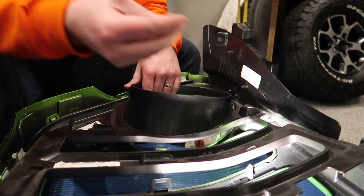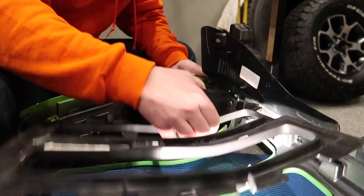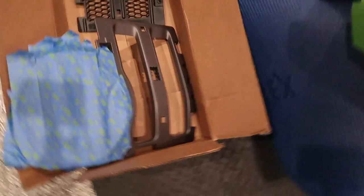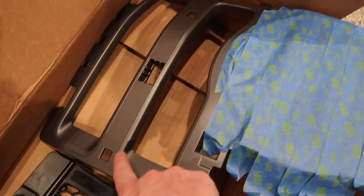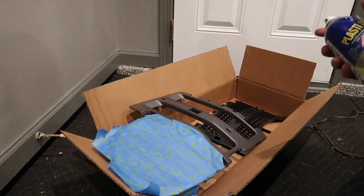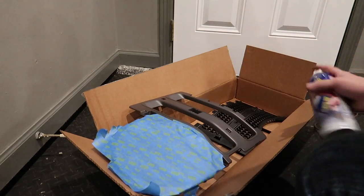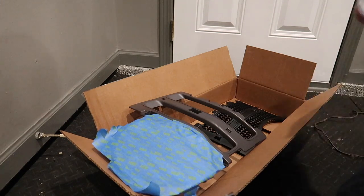You can just pull up on it and it pops off. With it out, I masked off the headlight bezel area because that's the only part I don't want to spray. We want to get this whole surround for these two grill pieces with the red. Whatever I don't want showing here will be hidden behind the grill anyway, so I masked that off and I'm going to spray this all as one. Plasti Dip says to apply a first light coat spreading evenly across all the items, working it at different angles so you catch all the cracks, then come back with multiple coats — they suggest at least four coats. So that's what I'm going to do.